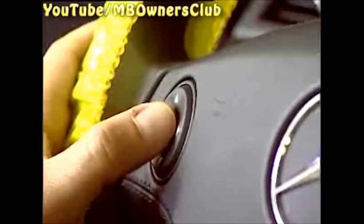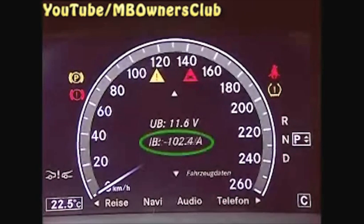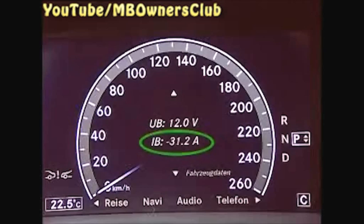The charge or discharge current of the battery can now be displayed at any time through the menu vehicle data in the instrument cluster. This way, it's easy to keep an eye on the battery level. The menu functions along the lines of the model 221 before the 2008 change. When you enter the menu vehicle data, press the OK key. Now you can read whether the battery is in the charging or the discharging state. If the ignition is on, the battery will discharge and a minus appears. If you start the engine and the generator charges the battery, the battery is in the charging state.